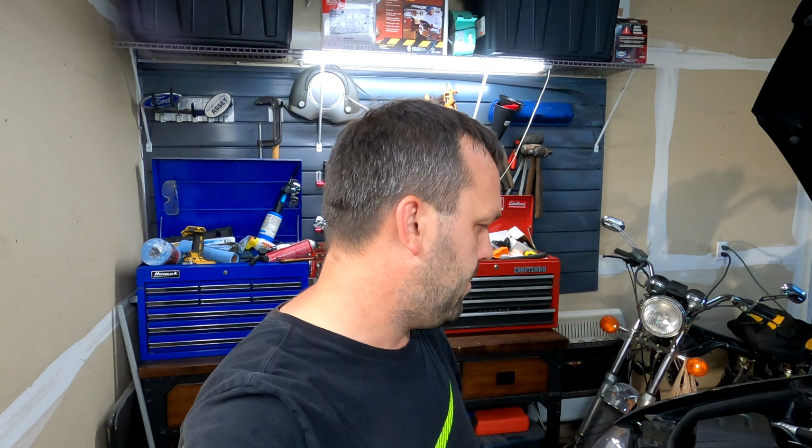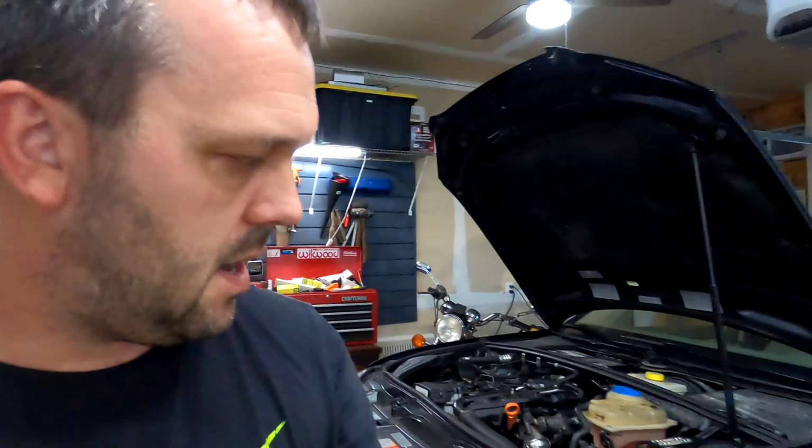Well, don't feel too bad for me. I did know this was a possibility when I bought the car, right? And that's part of the reason I got a good price for it, is this drama was going on. So I got it up in the air right now, and I'm gonna just give you a quick peek of what's in store. I'll show you from the bottom, but basically we have to remove the subframe to drop the oil pan so I can drop the oil pump. And that means we're gonna remove the support for everything you see here, basically.